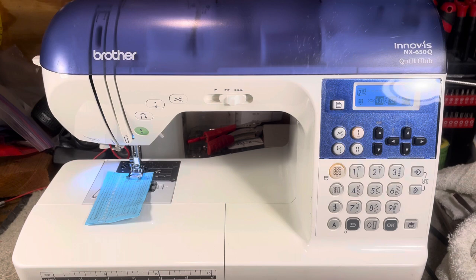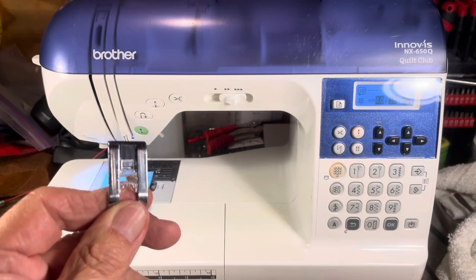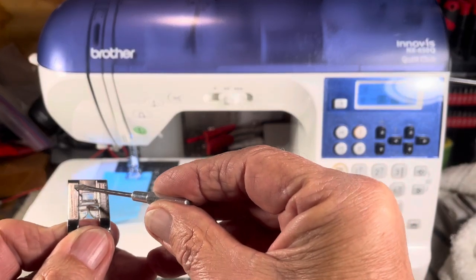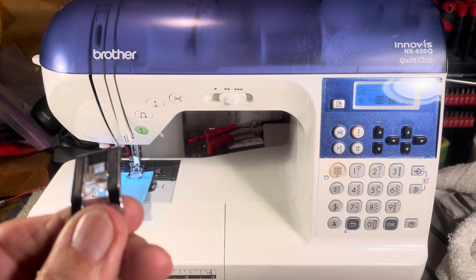The reason we got this one in today is because it was feeding sideways — you'd take off and the fabric would go sideways, it wouldn't feed straight. That's sometimes a mix of the pressure on the presser foot, the presser foot itself, or the feeder being crooked. This was a combination issue: the feed dogs had cut into the presser foot. See how it's cut in there, and they were on crooked — at an angle. Those lines are not parallel to the edge. The feeders were on crooked from the factory, fresh out of the box.